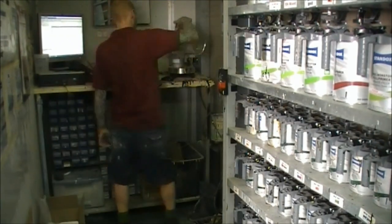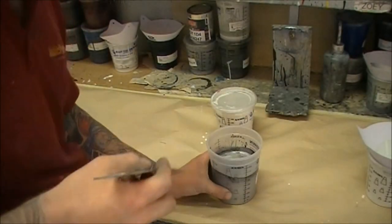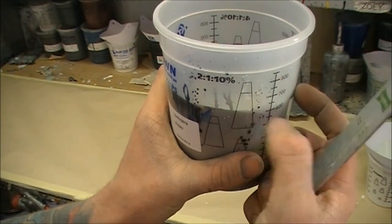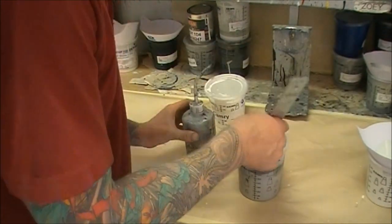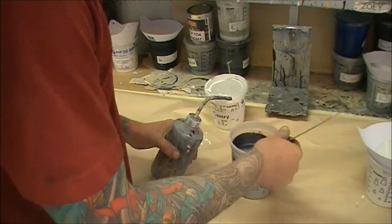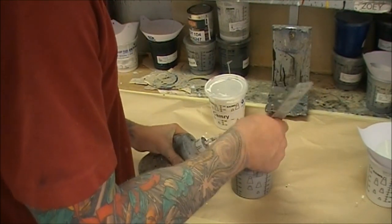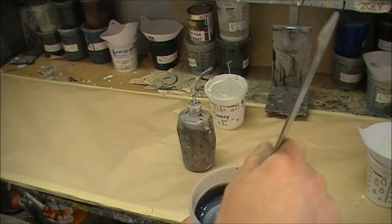Be careful when you're putting your tinters in — you don't overdose because you can ruin the color. We'll then mix it up at a two to one ratio with reducer or paint thinners. I've been doing this for a while so I can just thin it down by eye. I don't go by the two to one ratio — I can figure it out just by looking at the stick and how quickly it will run off the stick.